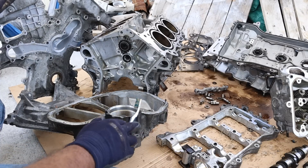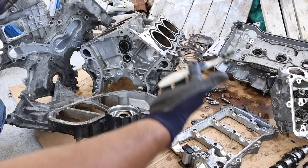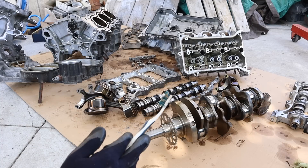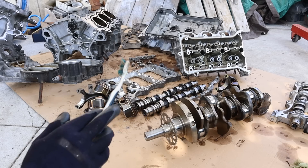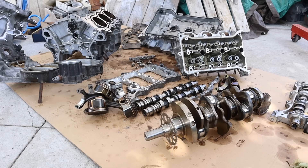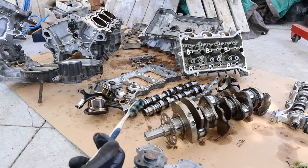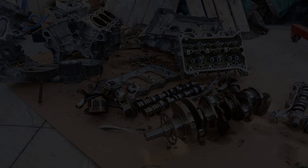While the GR series of engines have proven themselves fairly reliable, I don't really like the design of this lubrication system because the oil has to travel through so many different components — which creates failure points where oil could leak and you could lose oil pressure and possibly damage your engine. Essentially, oil comes from the oil pan into the timing cover where the oil pump is, then to the upper oil pan to get filtered, then back into the timing cover, then into the block, then from the block to the heads, then from the heads into the valve train, then from the valve train back into the heads — and there's a separate circuit for variable valve timing that goes into the valve cover and back into the valve train again. There you have the infamous 2GR 3.5 liter V6 engine from Toyota. Time will tell if the replacement 2.4 liter turbocharged engine will last as long — but if you've got one of these, make sure you keep an eye on that water pump so this doesn't happen to you.